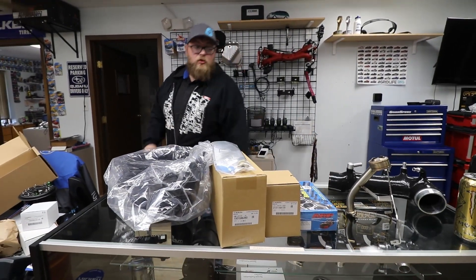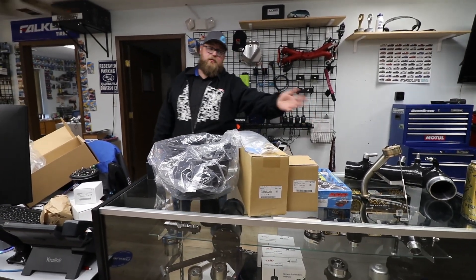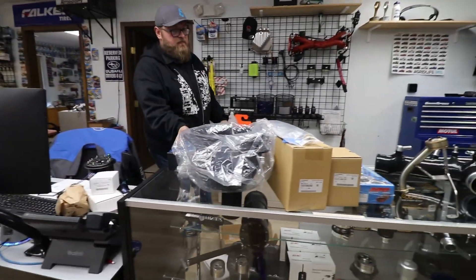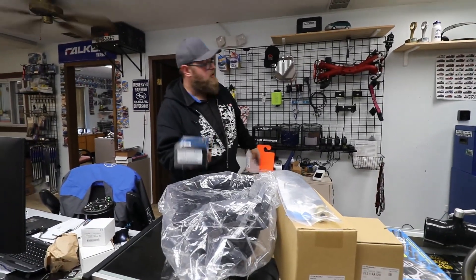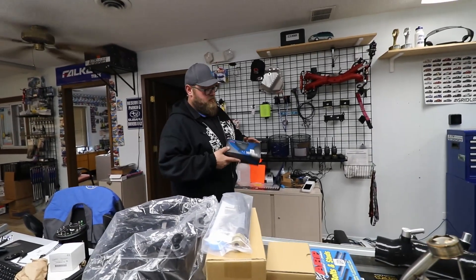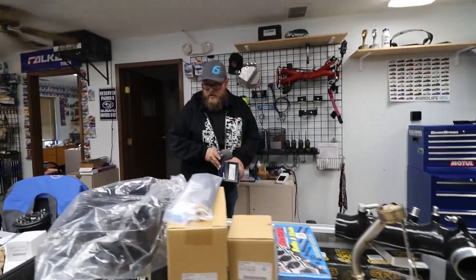Another part toward the reliability kit: the turbo inlet hose. If you don't have an aftermarket one, we put it in with every build — this is the metal manifold version. We also have the plastic manifold version, always in stock. Lastly, for your setup on top of the Sierra Six kit: Injector Dynamics injectors, paired with a Fuelab six-micron filter so you have a nice clean injector for ethanol — because you never really know what's in there with flex fuel.